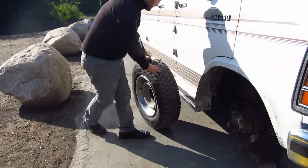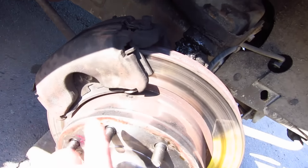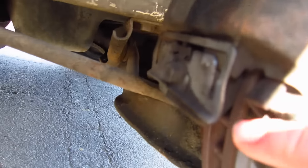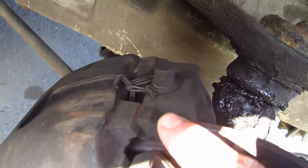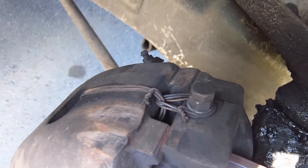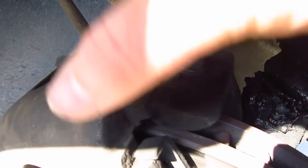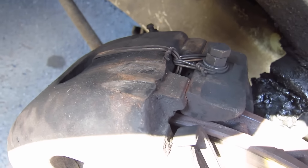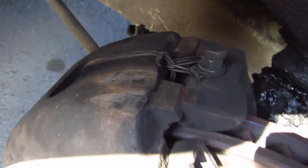Now we'll inspect the job I did before with the wire. Here is our brake caliper — this is what holds the brake pads on the rotor. Whenever you press the brake, it squeezes these two pads onto the rotor and stops the wheel. The problem was a clip down here that is supposed to be up here as well but is unfortunately missing. On the Trans-Labrador Highway — the really bumpy road — it vibrated out the bolt that holds the clip in, so it flew off. That meant the caliper could rock up and down, and eventually it rocked up so much that it got jammed inside the wheel well and locked it up, kind of like your brakes being locked.